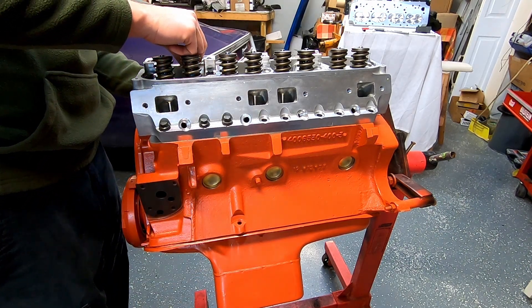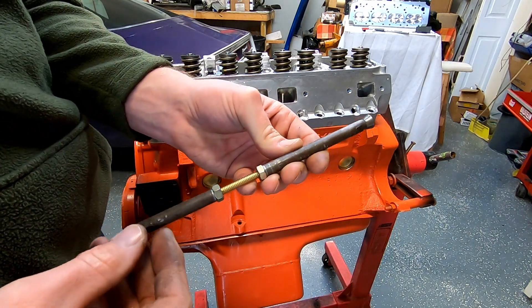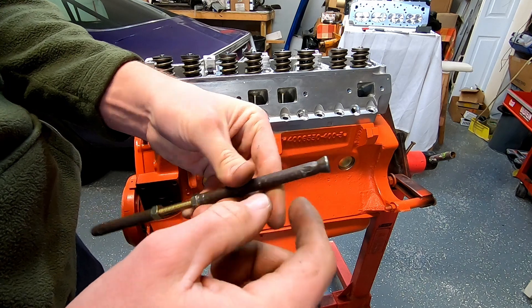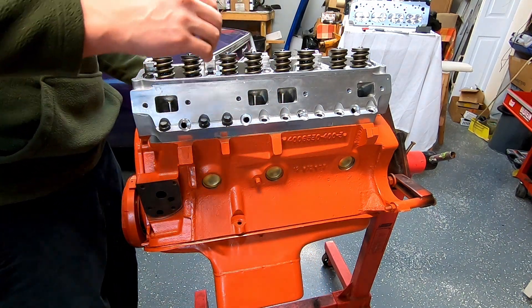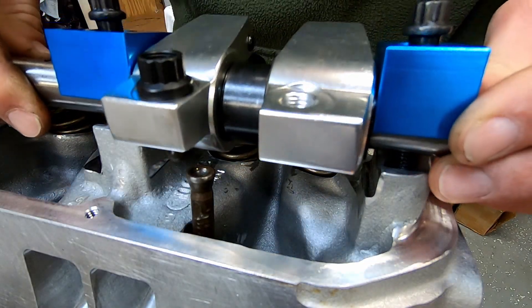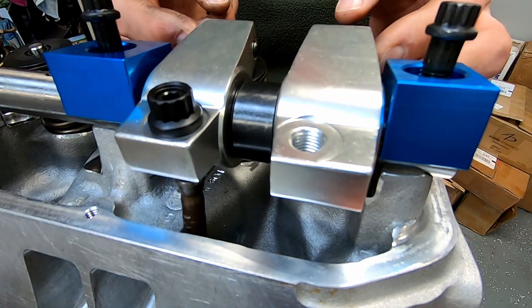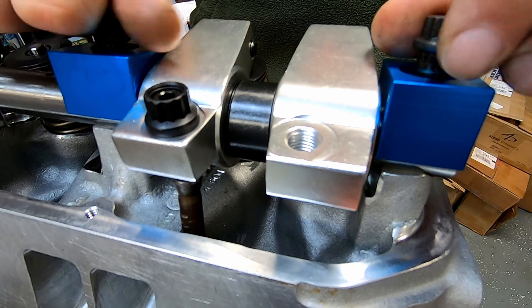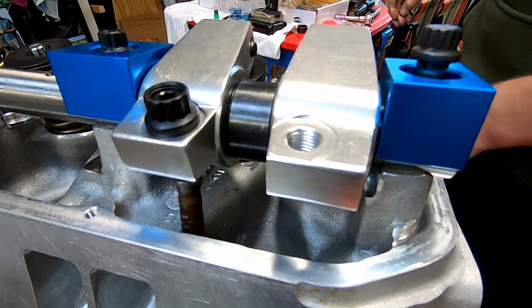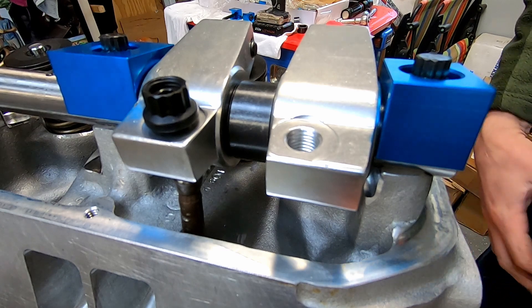Let me bolt my head back down. This is my measured push rod from earlier — it's pretty close, I know it's not exact. What I did here was take a long push rod, cut it, splice a piece in, and tighten my nuts against it so it shouldn't flex, because this all-thread runs into each side about an inch. I'll start with my intake side. I did go ahead and do my side-to-side play on these — it's set fairly close to what it should be.